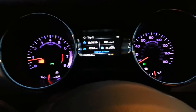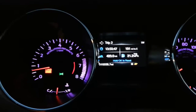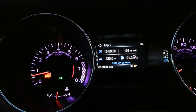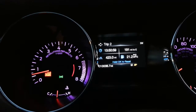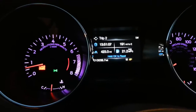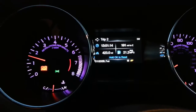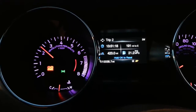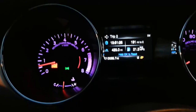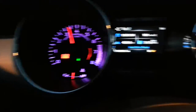But there is a caveat to this. When you're driving, you can leave it enabled, but it will reset every time the car is turned off, and then it will re-enable itself. By the looks of it, and I'm going by my assumption, it looks like it enables itself when it detects the same situation to enable the actual launch control on the fly. Even though, like right now, it is actually on, it's not technically enabled. Like right now, if I step on it, as you can see, it's not on right now because I'm in neutral. My foot was never on the brake, etc. So I would still have to put my foot on the clutch, put it in gear, depress the brake all the way, let off the brake, and then hold it. And that's how it keeps enabling it.